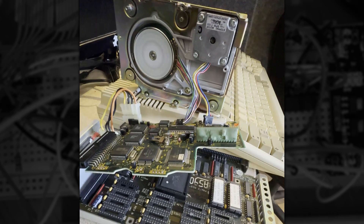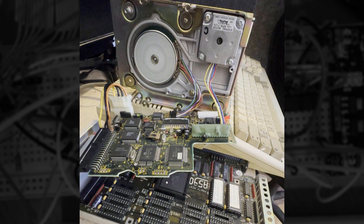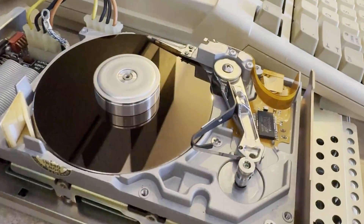For this first test I disconnected the read-write heads, so I've reconnected them and tried again. Weird noises — those heads are trying to move by the sound of it and I'm wondering if they're having the same issues as the spindle motor did. Looking inside, the heads are moving slightly. I suspect the motor failing to auto-start on its own may be to do with a problem with dried out capacitors, as there are no signs of leaks anywhere. So I've decided to recap the board.